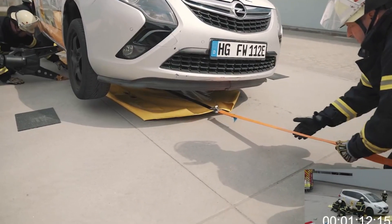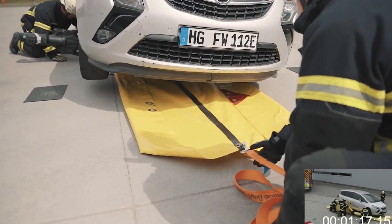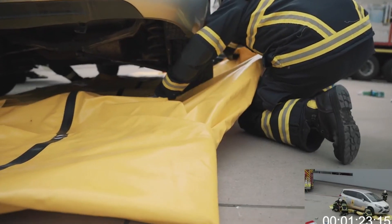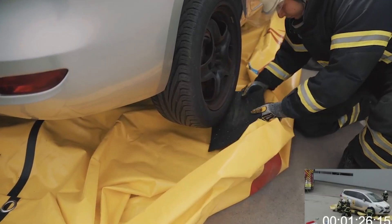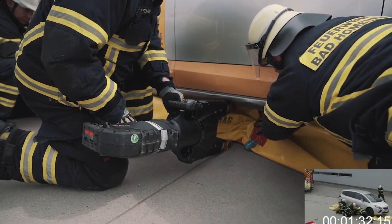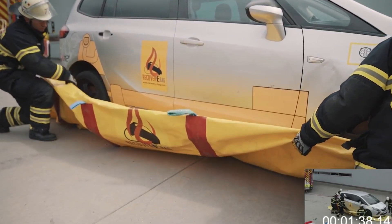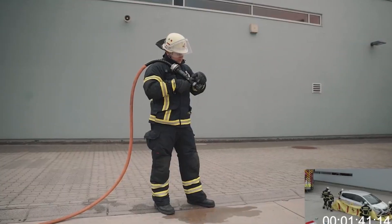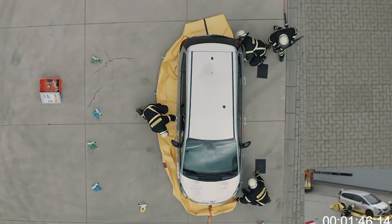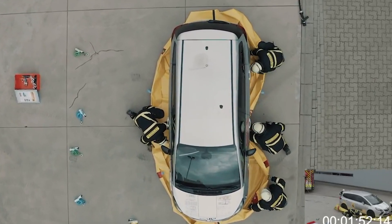Firefighting recovery bag. It is a large bag with which part of the burning electric vehicle can be covered. The extinguishing bag is designed to respond quickly to fires in electric vehicles regardless of location, thanks to its compact size and weight, allowing it to be stored without taking up much space and deployed with minimal equipment. It does not extinguish the fire but allows it to be controlled in seconds, isolating the vehicle before more radical measures are taken. Once placed, it is filled with 500 liters of water. Before the teams approach, the vehicle is cooled to about 70 degrees Celsius.